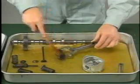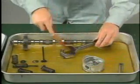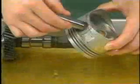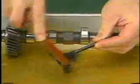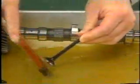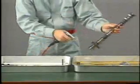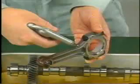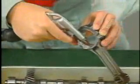Disassembled parts must also be cleaned. Check each part for carbon deposition and flatness and clean it. If parts are inspected without cleaning, it is difficult to find defects. In addition, foreign matter may adhere or enter during inspection, adversely influencing the performance of the reassembled engine. Washing and cleaning are extremely important in maintenance work.